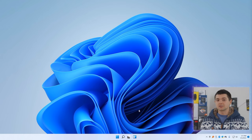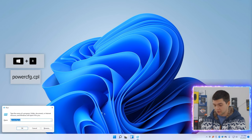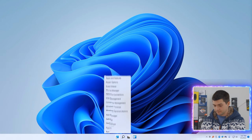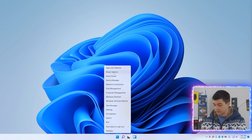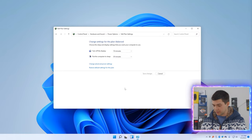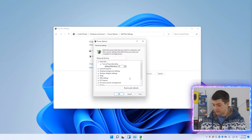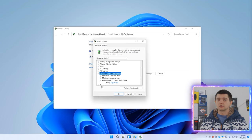Let's switch to my laptop screen. As I mentioned, switching the CPU Turbo Boost is very simple — we need to edit our power options in Windows. I'll press Windows+R to run the "powercfg.cpl" command to open the Power Options window. You can also right-click the Windows button and select Power Options. In the Power Options window, go to Change Plan Settings, then Change Advanced Settings. In the next window, find the Processor Power Management option. Under that, there is a Processor Performance Boost Mode setting, which is what we're looking for — it allows us to tweak the behavior of the CPU Turbo Boost feature.